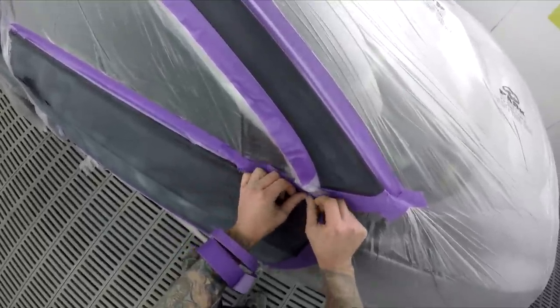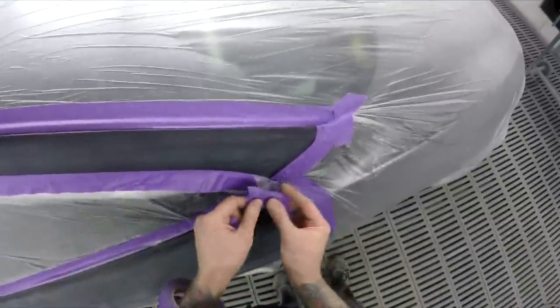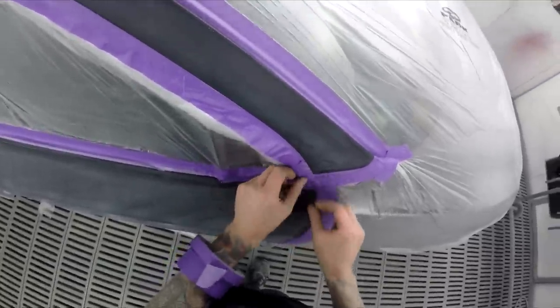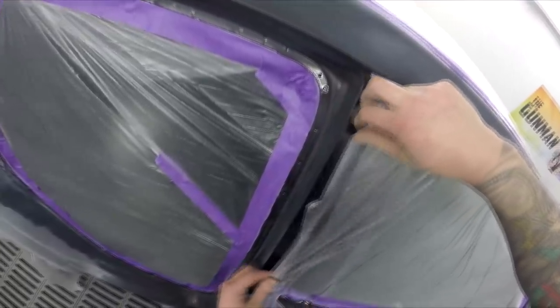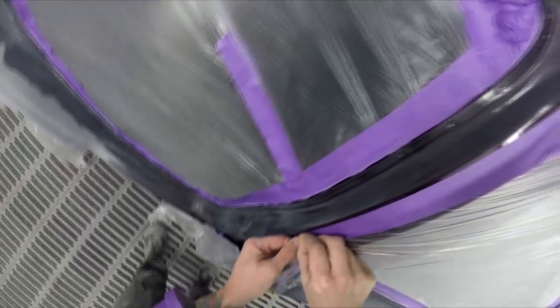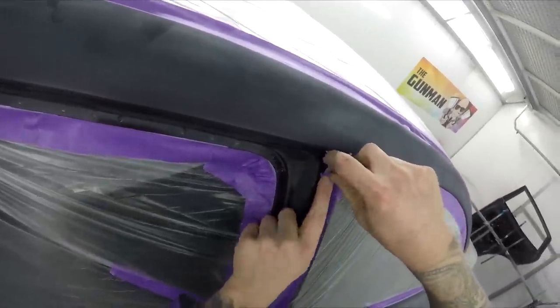But then the other side of it is that they used to have an air screw compressor, but then that air screw compressor died, and they just replaced it with a standard old school style belt driven compressor, and it just couldn't keep up with the air blowers. The guys out there would be sanding down, and you'd be in there trying to spray after using the air blowers, and you wouldn't even have enough air pressure to clear with. Another demand was the air fed respirator that I was using, using more air there. Yeah, so it's all good.